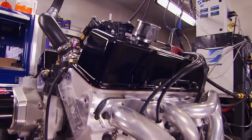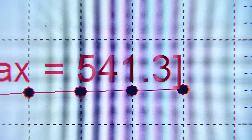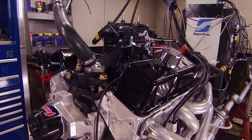We're up to 37 degrees — I think we found it. At 36 degrees: 541 horsepower, 473 pound-feet. We've reached our limit. After some shut-eye, we're picking it back up. But overnight we had a huge weather swing — the air went from cool and dry to warmer, humid, and rainy.